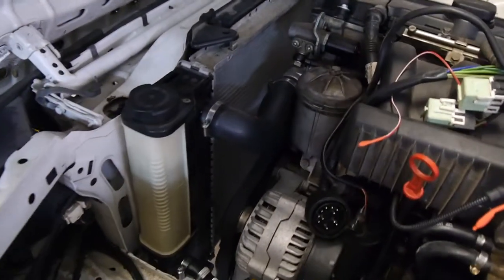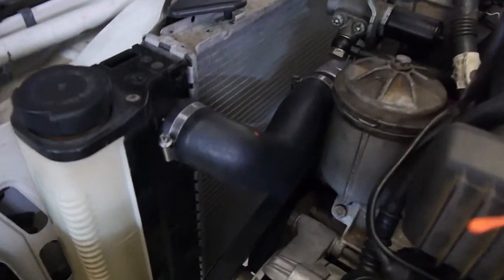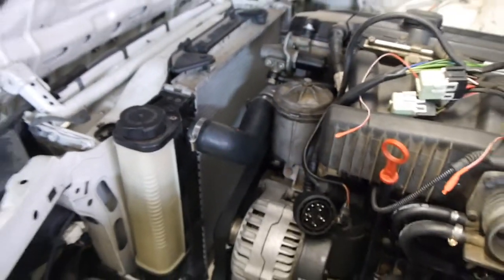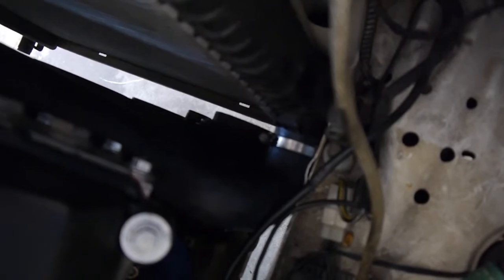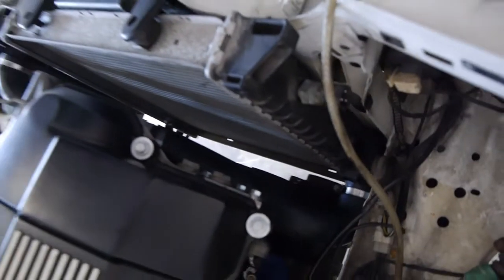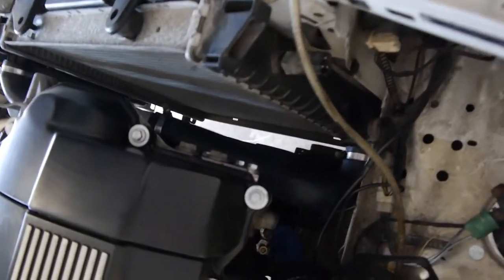To mount the radiator I've used two bottom E36 radiator hoses. This one required a fair bit of cutting but it fits really nicely. Going around to the other side, the second hose is a bit tight but all I had to do was cut down the bottom radiator hose to account for how much closer the engine sits to the radiator. Pretty easy overall.